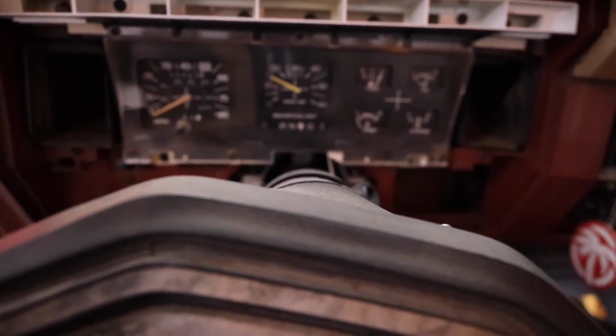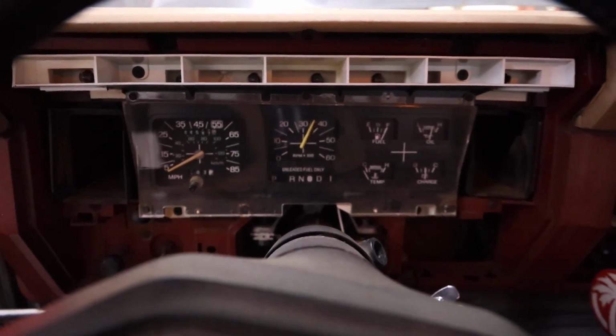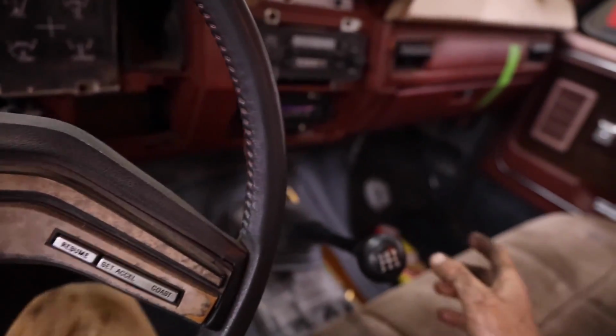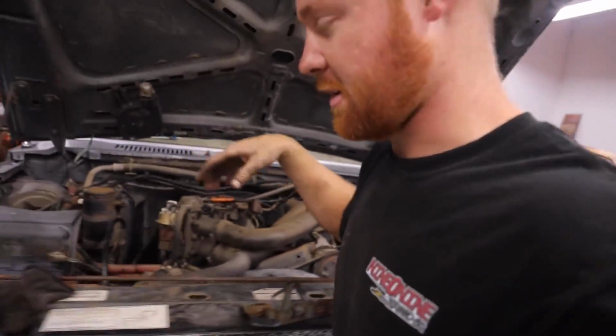It's doing that. Wow. Ooh, that was a good one. Okay, I don't know why it's doing that. I don't know what's up with that. I think it's because the O2 has no back pressure whatsoever. Probably running a little rich for whatever reason, but it runs perfectly, so I don't know what the hell's up with that. Oh, wait a minute. I didn't cap off the air pump. That's what's going on. Okay, yeah, that's totally easy.